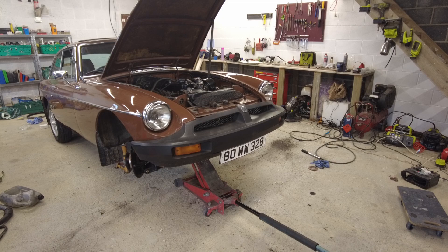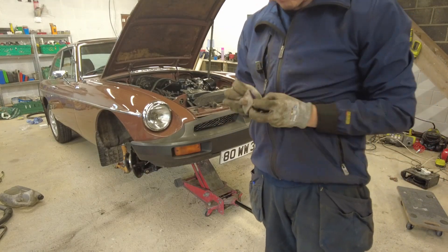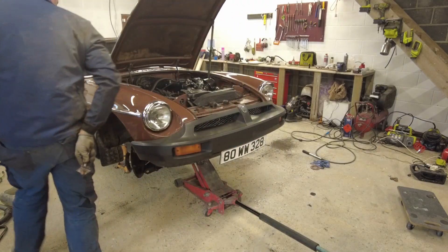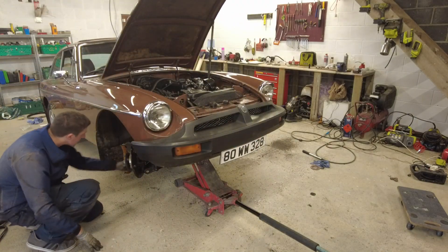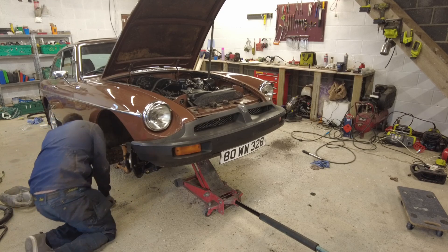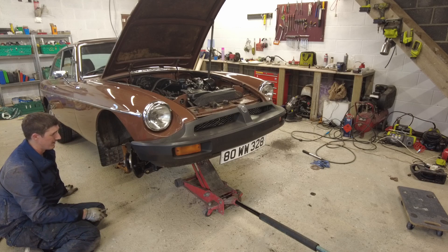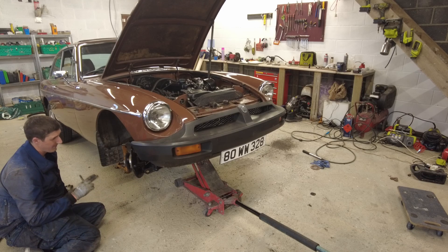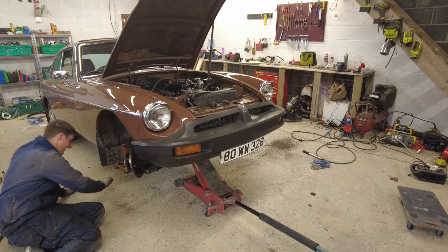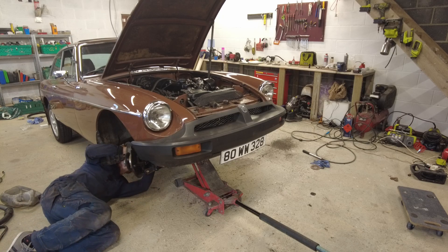What I'm going to do now is actually put one of the back ones on now, so I need my pad. I've got the nut on on the side where the thing is actually stuck. Let's get one on this side now. Don't put any body parts underneath the subframe by the way, especially when it's on a jack, because if it falls on your head it's going to kill you.